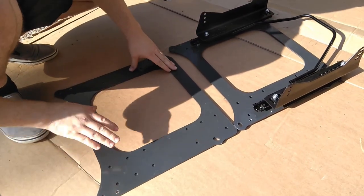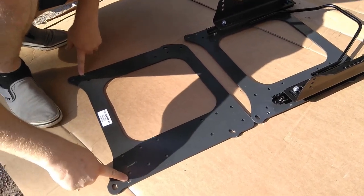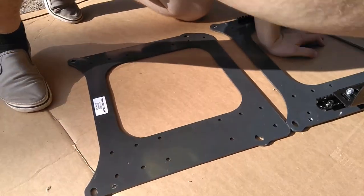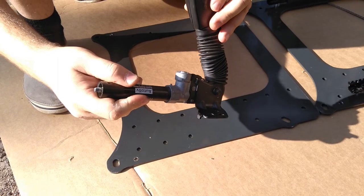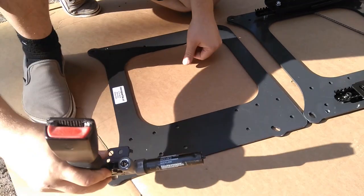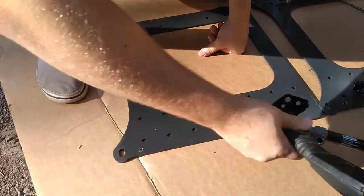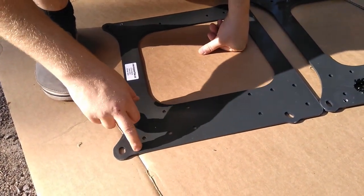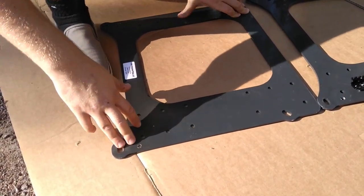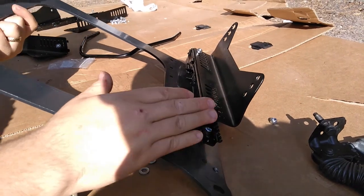I told you I ground off the L-shaped part — the hole is for this so it doesn't move around. I lacquered these already for rust protection; I haven't painted them to match because I don't have the colour, but they're lacquered so they should be rust-protected. The only modification I did was to attach the transmission tunnel side using a fairly long 6mm hex bolt, and I used two 17mm nuts as washers — because the seat came with four spacers already between the rail and the side mount from Corbeau.